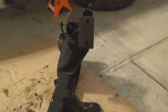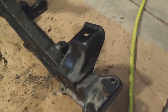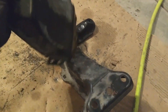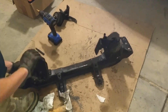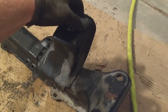As far as the cross member goes — that's the passenger side there — I'm not going to do anything with it. This is the driver's side, and I was able to get this off. If you look at the turbo cross member compared to the NA cross member, they're almost identical except for this piece right here — it looks like it's swapped around — and that creates a cavity right here in the car where the turbo can go. What I did: there are some little pins that just hold this to the cross member. I tried to drill those pins out the best I could, and then I used a chisel and hammer and was able to finish them off and get it off that way. The drilling took more time, but after that it came off pretty easy.